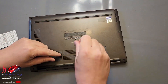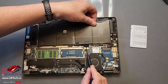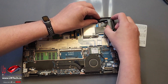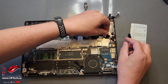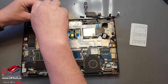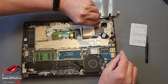We start by unscrewing the back. Battery is next — one screw, two screws — and then the speakers. You can just pry the battery up, you don't need to unscrew it, you can just leave it. Let's take out the buttons. Pro tip: when you are taking parts like this apart, make sure you put the screws with the part you took out, because otherwise when you're done you've got a lot of screws and you just don't know where they came from.